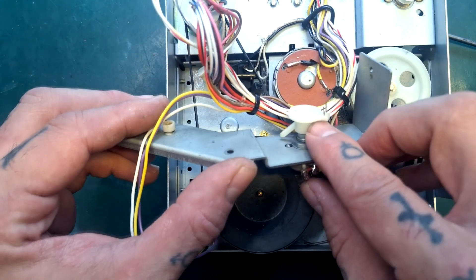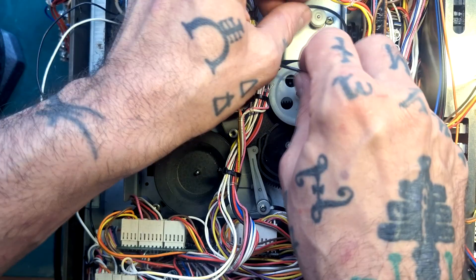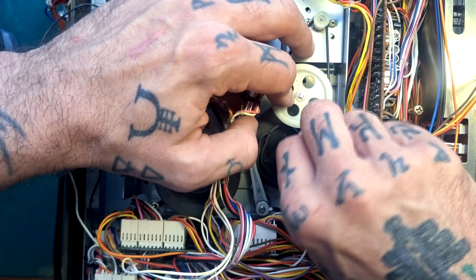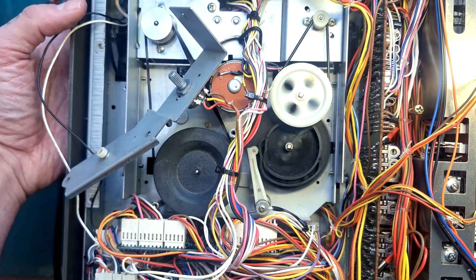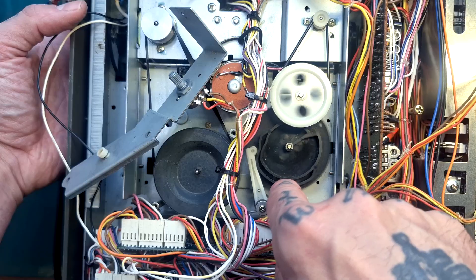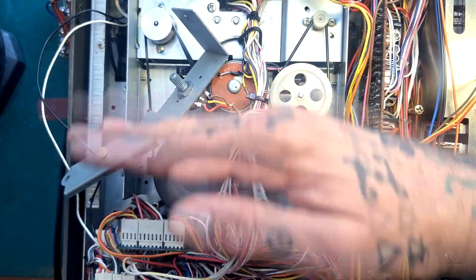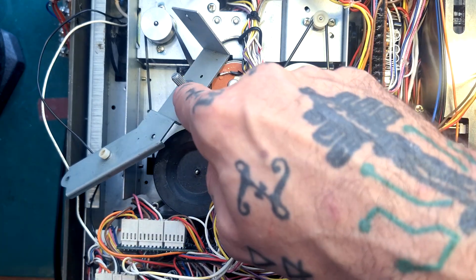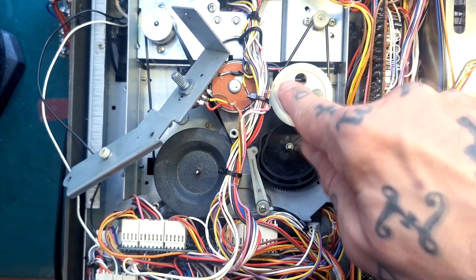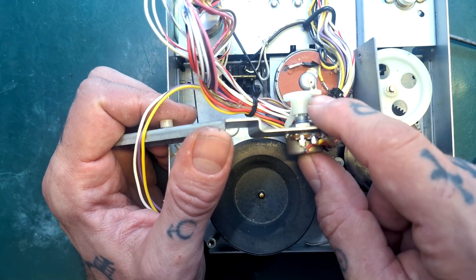If that is snapped all together, the motor will turn this continuously and you'll see the heads go up and down repeatedly. What's happened on this original part is those white plastic lips have broken. If the belt is intact but the clip is broken, when I first turn on it just runs forever — the heads go up and down continuously — because the control board never receives the resistance it wants to halt, since the pot and the black gear aren't connected.